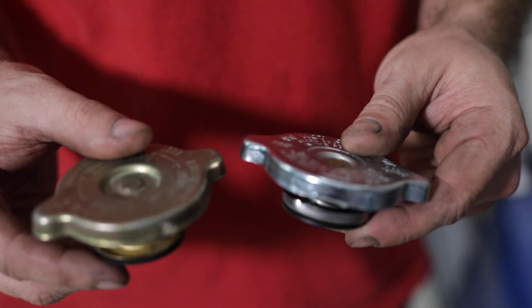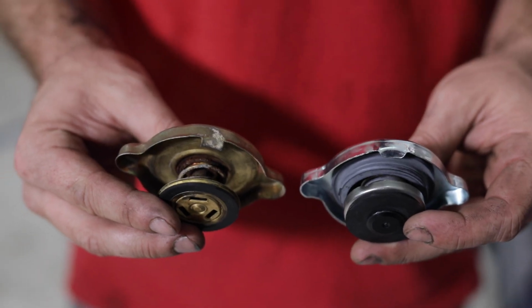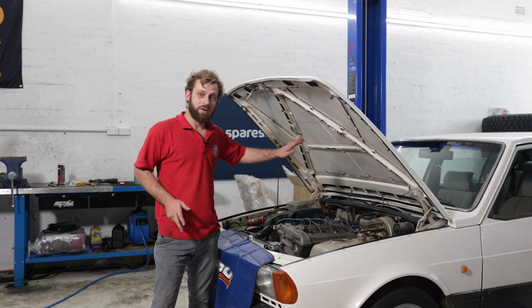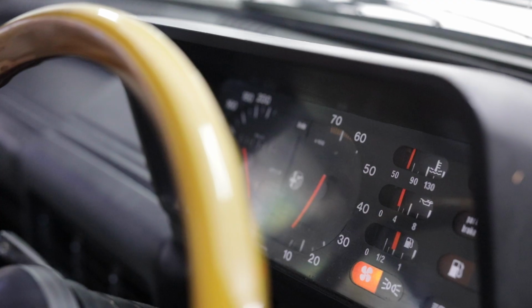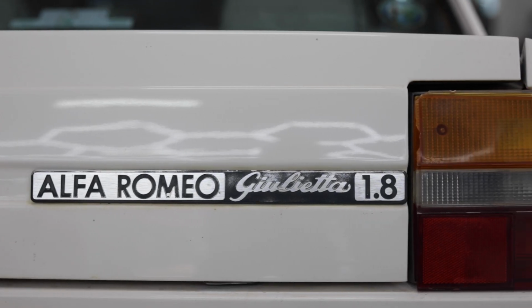Now I always take the opportunity to replace these whenever I do coolant, as we don't do coolant that often on our cars. These are only a couple of dollars and very important to the health of your cooling system. The last step of this should be going on a test drive with the car. The heater should be hot, the car should maintain temperature properly, and I always like to check the level again the next morning before I take the car anywhere, just as a secondary check.